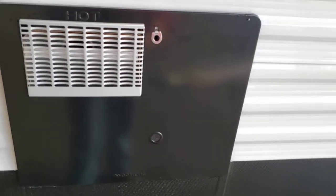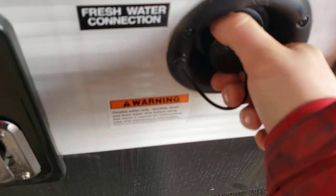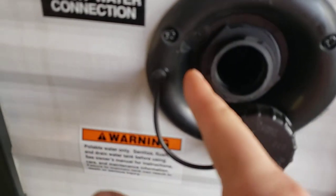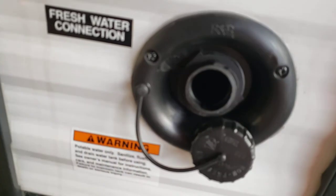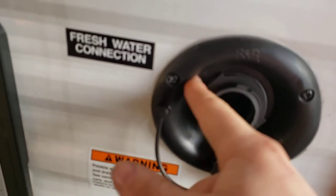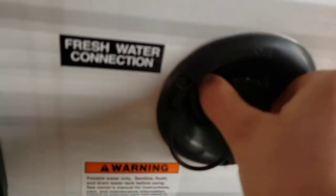So you can avoid all that by keeping it clean. Fresh fill — stick your hose in there, don't jam it in there, just rest it in there. Turn your hose on and that'll fill the onboard tank. Right there is an overflow, so if you start filling it, water will come out of there and escape around the hose too. That's why I don't recommend jamming your hose in there — if the overflow gets pinched off or is dirty and water can't escape, now you're pressurizing your fresh tank and you don't want to do that.